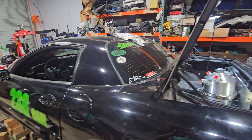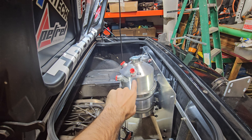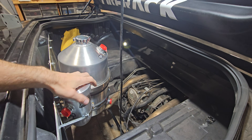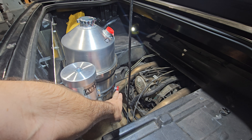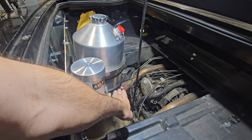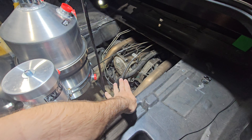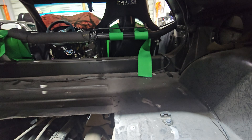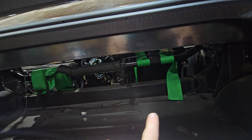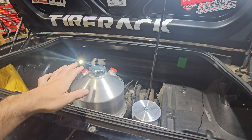I did some pre-research - I've never done this before. That's why this is a four gallon tank with dash-16 lines, because you want bigger lines and they also hold more oil. The pickup line - where the pump picks oil up from the tank and brings it to the engine - needs to be above the engine. You'll see it's slightly below this frame rail, so I'm gonna have to come out and go slightly up, go forward. C5s have this thing right there, so maybe I'll cut through it so the line goes flat, then run it right down the passenger side to the front.